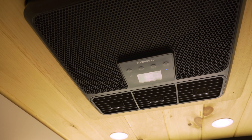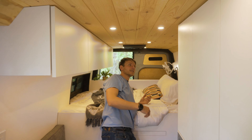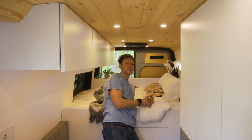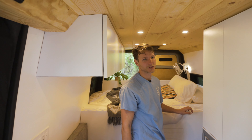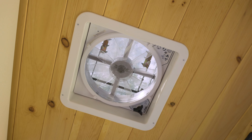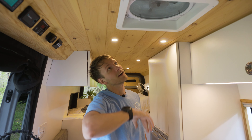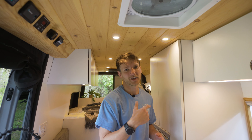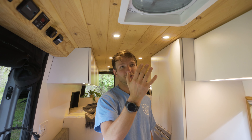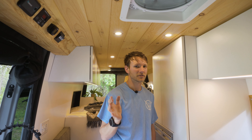We have our favorite air conditioner — this is what makes our vans four-season. We have a diesel heater that's 12-volt and a 12-volt air conditioner that can run on this battery system for over 60 hours, which is even more mind-blowing than our previous builds because that system is huge. You can run this fan to suck all the air out of here — it opens up automatically like so. Opens the lid, doesn't let any rain in. It's actually really quiet. You're just hearing the motor that opens the lid; the fan motor itself is silent — you can't even hear it.